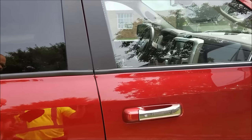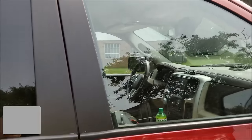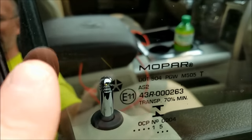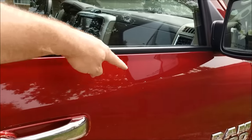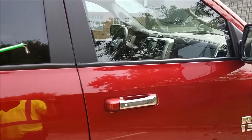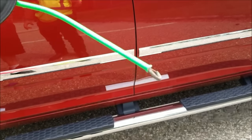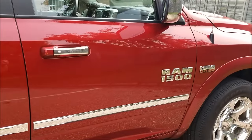Now, if I wasn't explaining this job, I could probably open this truck in about 15 seconds. Compared to the old Slim Jim days, this is it. Now, granted, this only works on cars that have a vertical lock — the locks that go up and down like that on the door panel. Obviously if it's way down inside the door, it requires a different tool. But a lot of cars had that style lock years ago and they never really went away. That particular style lock is very common even on today's newer cars. So this tool is very handy to have — they're very inexpensive, I think they're under $40, and I'll put a link down below in the video description.